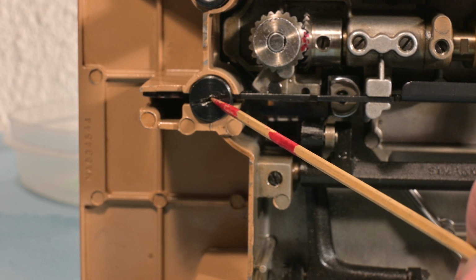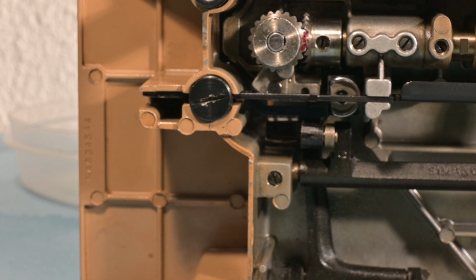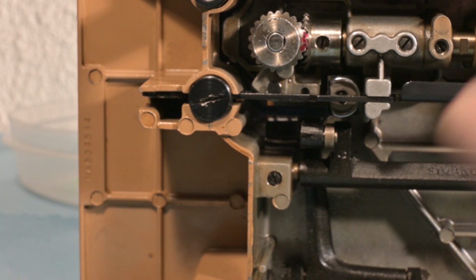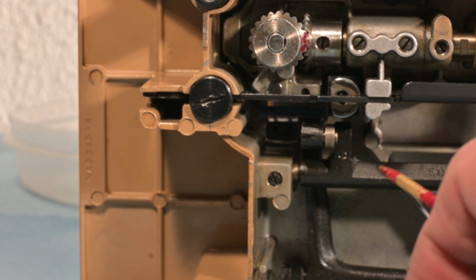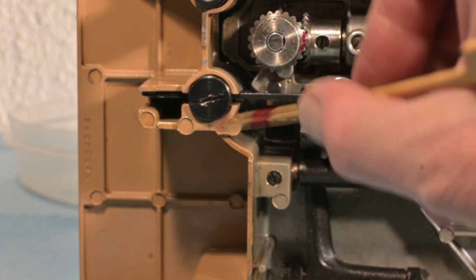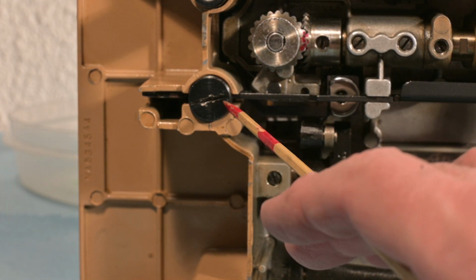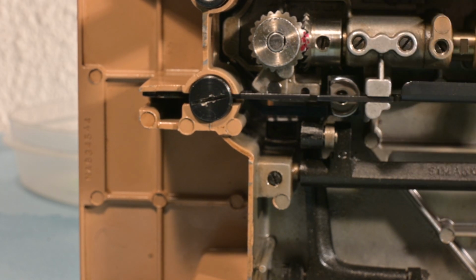And this is how I was able to adjust those pins at the top that the throat plate slides into. And those pins, where the throat plate was situated on the bed, where those throat plate clamps, I guess? I don't know if I'd call them that, but that's where they are. One is there, that's the right one, and then behind this nut is another one just like that inside there. And that's why I say the way to adjust how high the throat plate goes up or comes down is by that nut right there.